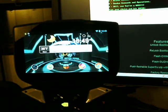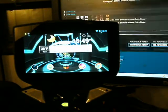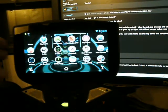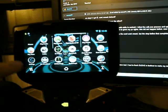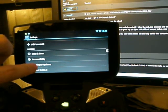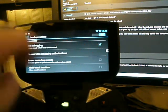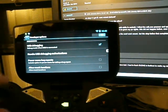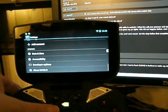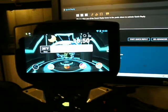Once you have the ADB, the Fastboot, and the image file, you're going to turn on USB debugging. To do that, on the Shield go to Settings, go down to Developer Options, and there it is — USB debugging. If you don't have Developer Options, remember go to build number and tap it about seven to ten times. Turn on USB debugging. When you turn on USB debugging, you can send commands from the computer to the Nvidia Shield.